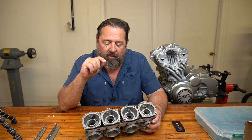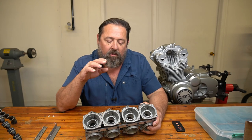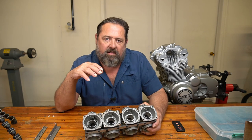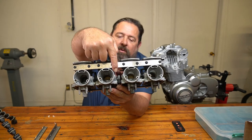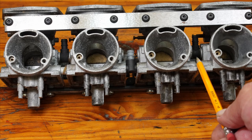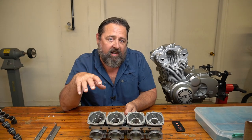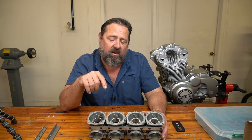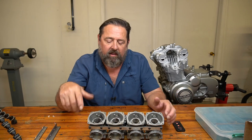Something that I'm concerned about, other than the cosmetics, is the functionality — a problem I was kind of aware of, and I talked to some technicians about it. These little fuel connectors right here, there's three of them, and they have O-rings in there. This bike being from circa 1981, they more than likely will leak eventually. So those O-rings need to be changed, and the only way to change those is to break the bank apart, change the O-rings, put them back together. That's how I'm justifying doing this other than cosmetics.